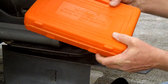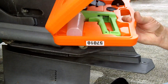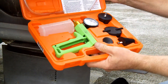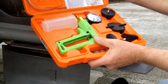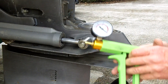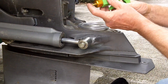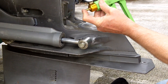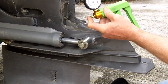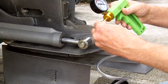Inside, this is actually called a vacuum pump tester, power steering, and brake bleeder kit. It includes a bunch of adapters. It has a vacuum pump right here — this is what we're interested in — and that is also a quarter-inch barb fitting. This is what we're going to use to pull vacuum. Before I do anything, I put my finger over it to make sure it holds vacuum, because you don't want it leaking internally and think it's something in your out drive. This one is holding good.